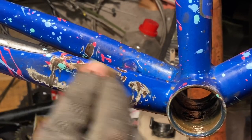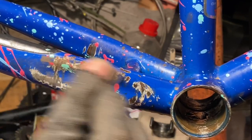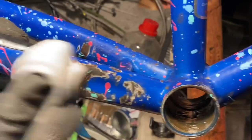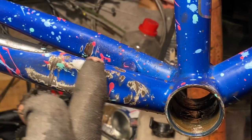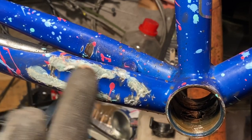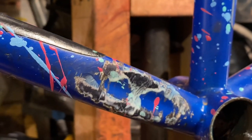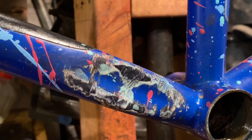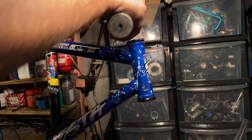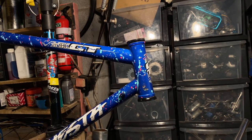After the paint splatter, I went over patches of rust with some rust converter. To prep, I used soapy water and a scotch pad, then isopropyl alcohol to make sure it was nice and clean. Then I just used my finger to paint on the rust converter — I do this when there are only one or two patches and I don't want to clean a paintbrush. Otherwise you just brush it on and it turns black.